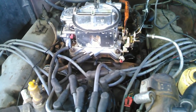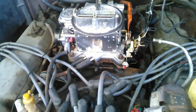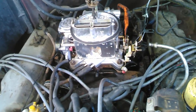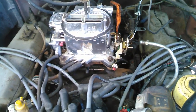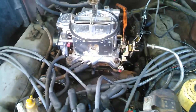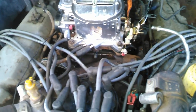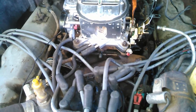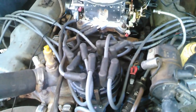There was no helping it. If I held the throttle it would run for a little bit, but the way it was acting made me think it was a vacuum leak. At the same time, I wasn't sure if it was getting the fuel it needed. I don't think it's spark related, because even when it wasn't hot it would still die pretty much instantly — and usually spark issues are either a grounding problem or happen when it's hot.